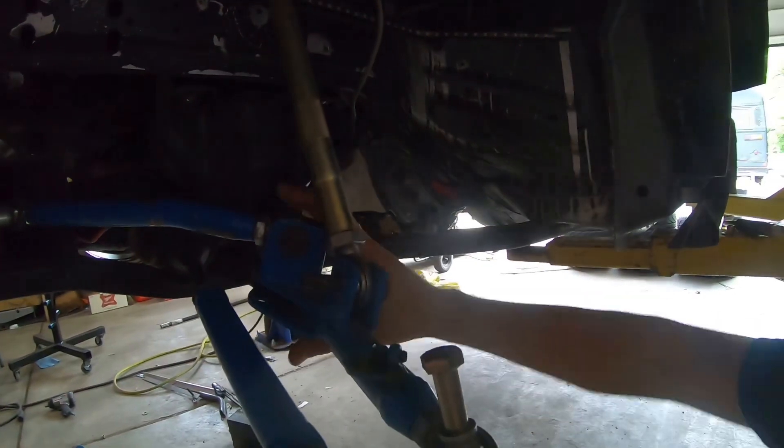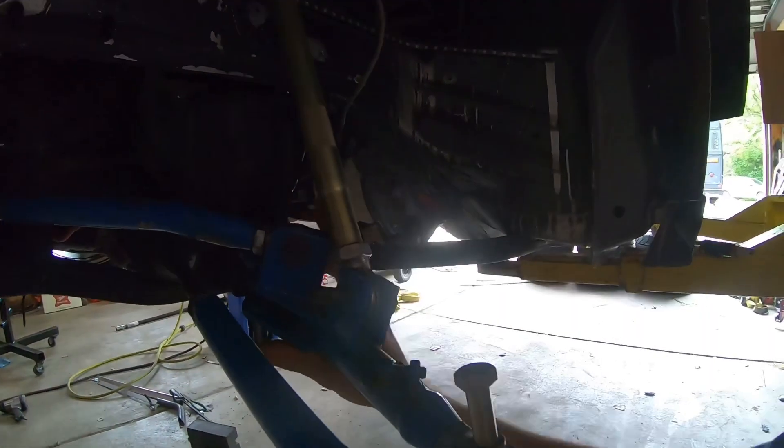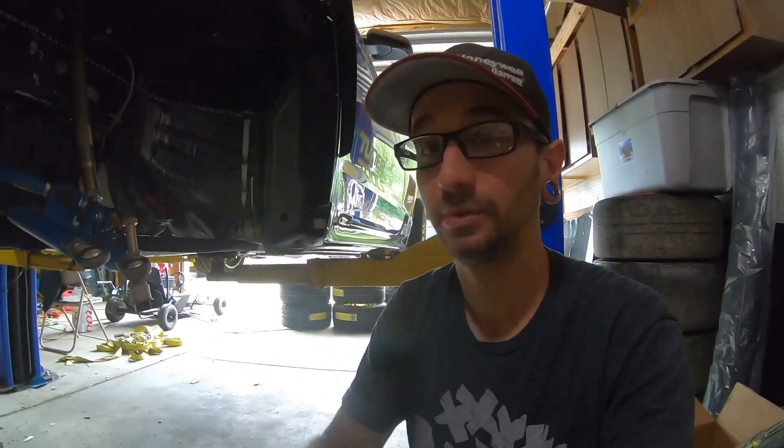With it going that way it can allow the control arm to rock back and forth, which causes all kinds of suspension angle changes. It was a really bad idea. I was hoping I could tighten it down enough to prevent that, but it still did — so that was mistake number one.